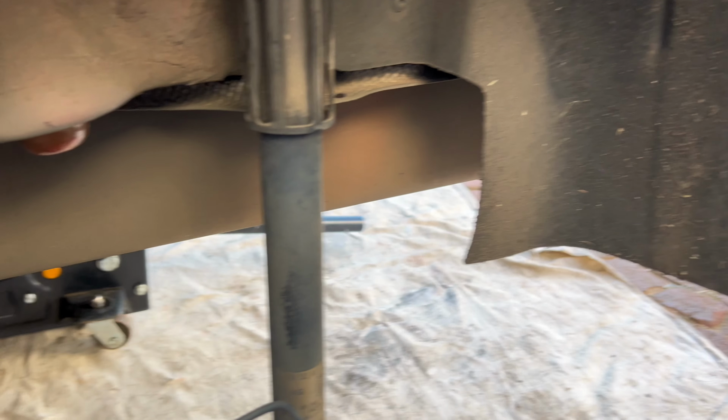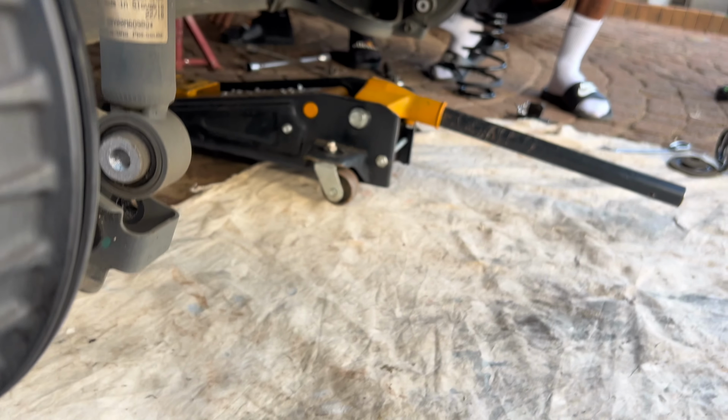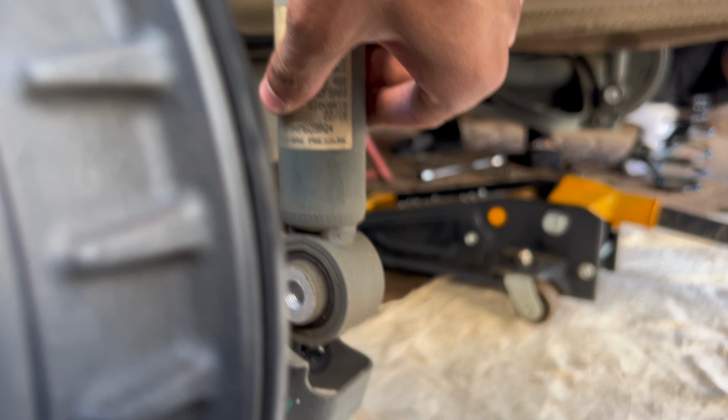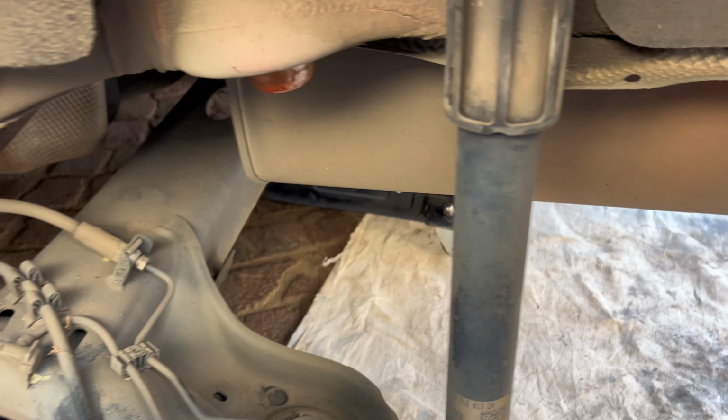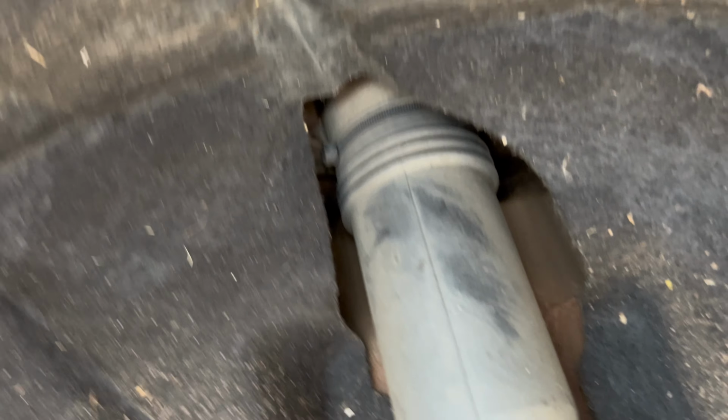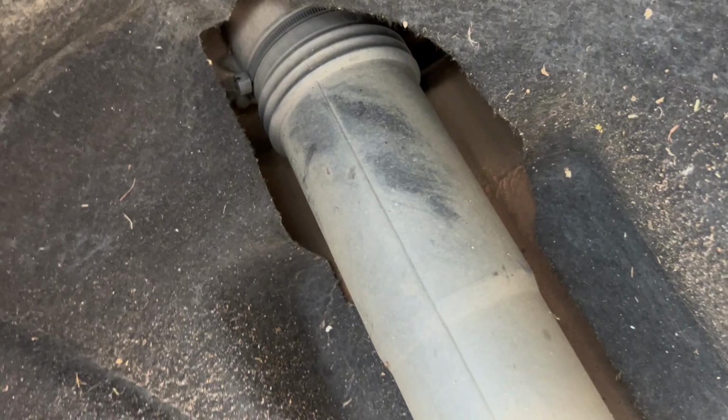Hit me up. So 10 minutes in, we remove both the bolts from the shocks. Simple, so you just pull these bolts out like that. It was sitting inside there. Then afterwards, we just remove both the springs. It'll be easy. So now we just need to remove those bolts there. But this cover is blocking, so now we just need to remove this so that we can get to those two bolts there. If that makes sense.